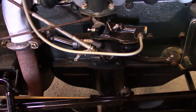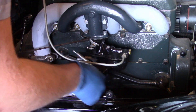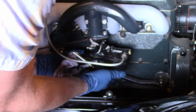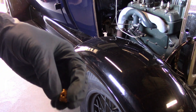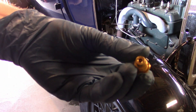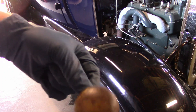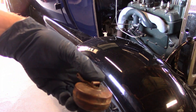This is pretty normal for a new restoration. This carburetor is supposed to be rebuilt and road-tested ready to go. It looks like it's got a reproduction needle and seat — I don't know, maybe it was just a jammed float. The float hasn't sunk, although it's kind of beat up, so I'm just going to assume this got jammed open, put it back together, and see what happens.